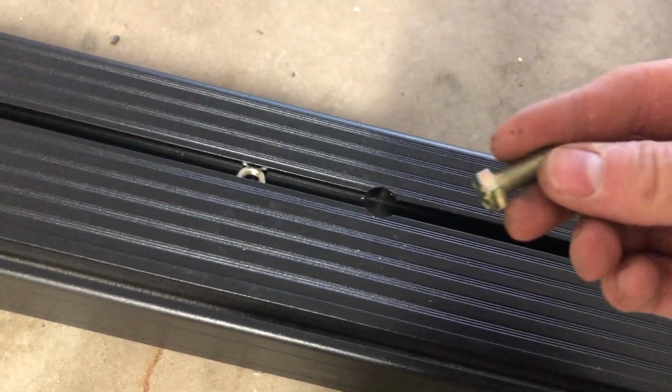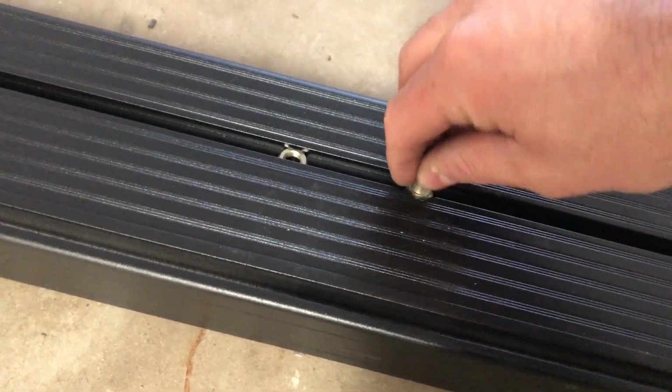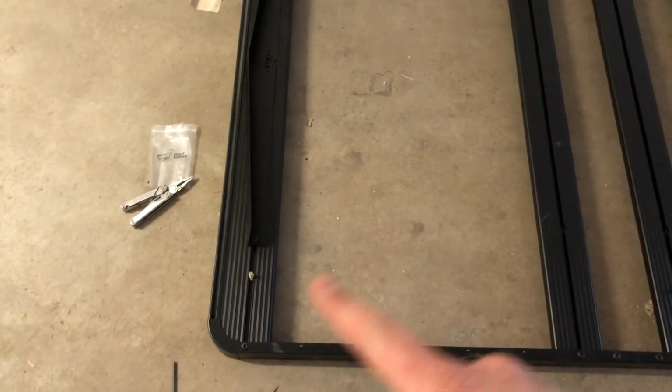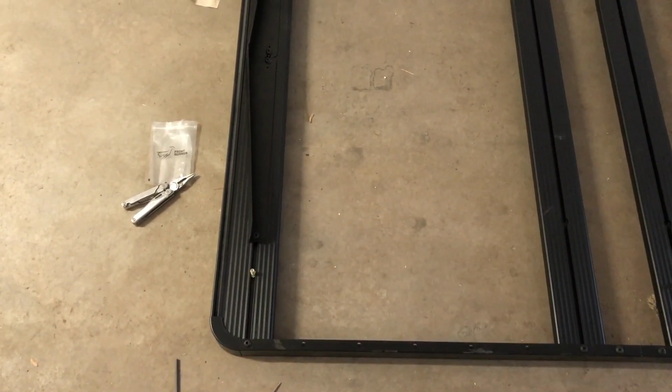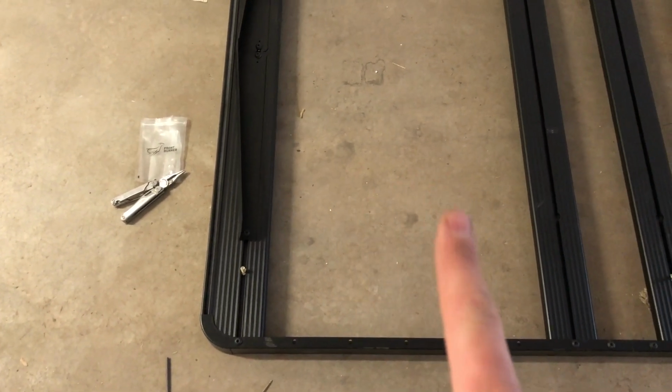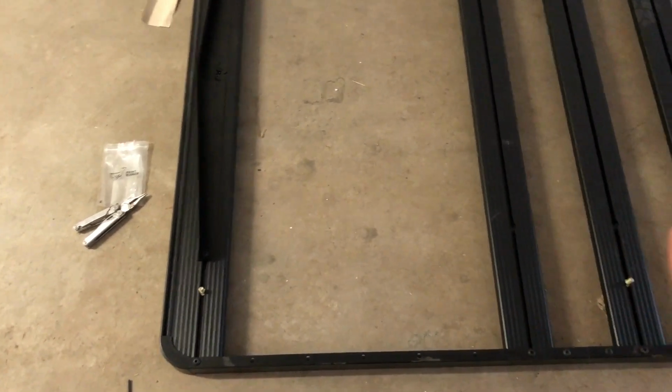Last step, take the M8x20 bolts and place them on each end of the slats, where the foot railing will line up with the bolts. My setup is a little bit different since I compensated for the moonroof to be used, so I removed 2 of the slats, one of which should have been used to secure the bolt to the foot railing. To have a better idea where the bolt should be placed for the foot railings, have the foot railing sit on top of the roof rack to get a general idea where the bolts need to be placed.